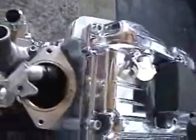Once you get to the throttle body, pull out the front injector first. When the front injector comes out, you rotate it toward you — which is toward the alternator cover side — and then you can pull out the rear injector. That will allow you to lift the whole entire body right up out of there.